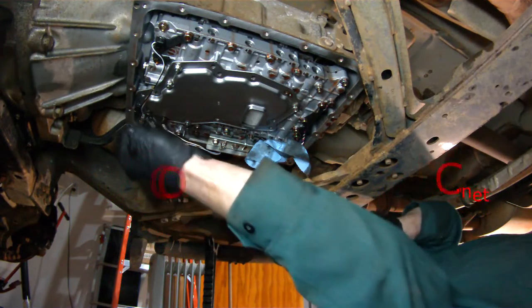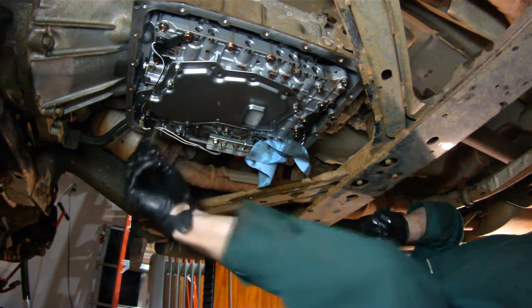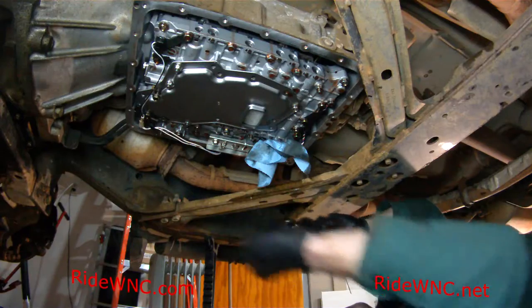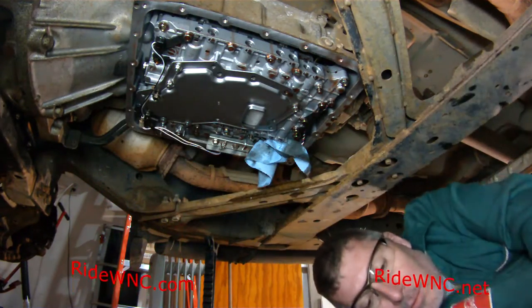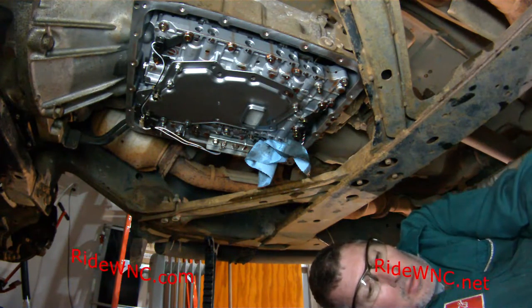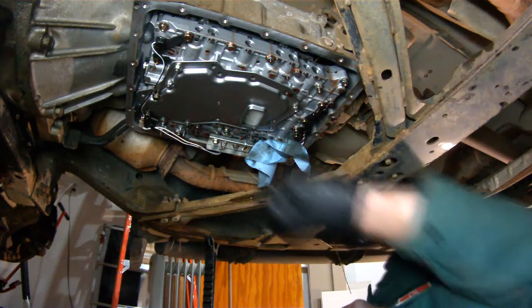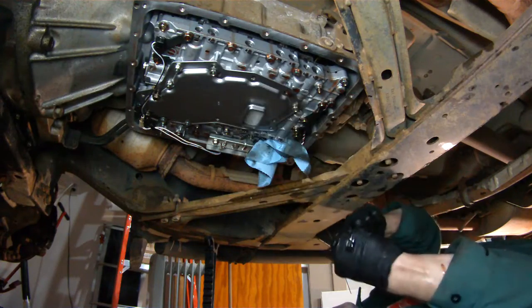I've got the PCV valve coming because this has a low oil pressure. The oil pressure's not working, and it blows smoke really bad when I start it up. I'm pretty sure the PCV valve is clogged up. So I've got one of those coming. I have a new oil pressure sensor coming. That should fix my oil gauge on the dash. I had some other emissions vacuum switches coming.